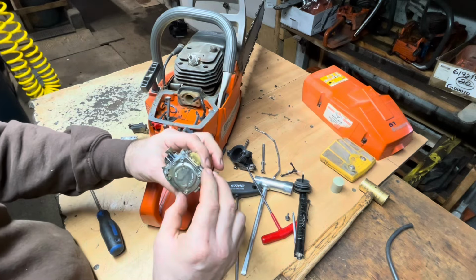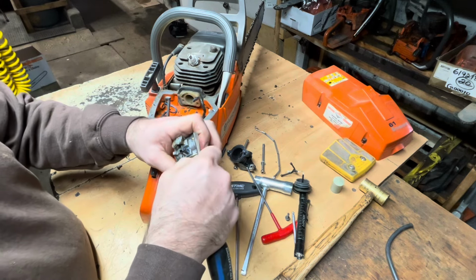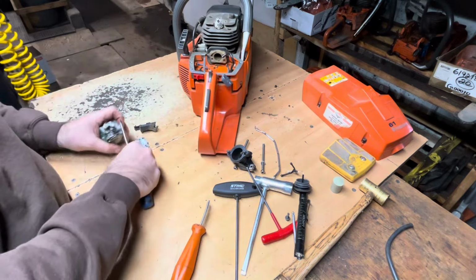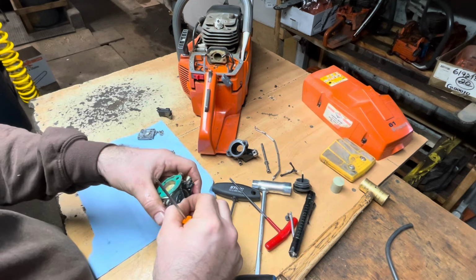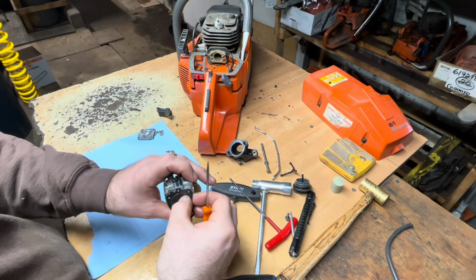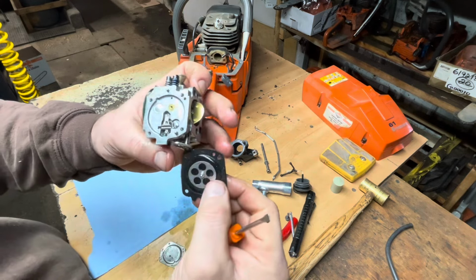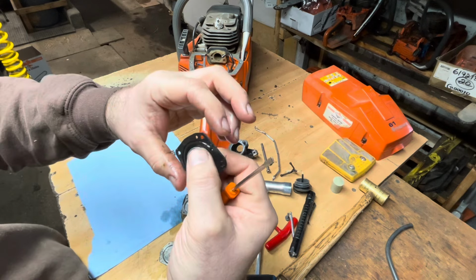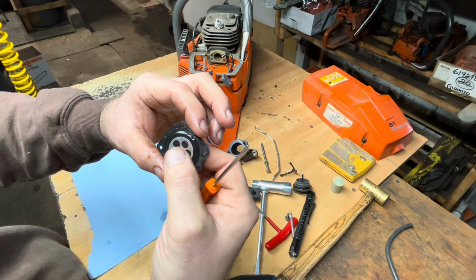There's the air compressor. Just pull the diaphragm side off. Get the saw out of the way. Oh, this is one of the ones where the diaphragm hooks to the metering lever. There. That diaphragm's old. It's snapping when I, don't know if you can hear that. That's definitely no good in my books.